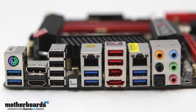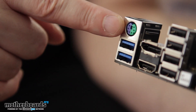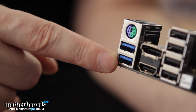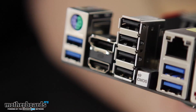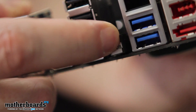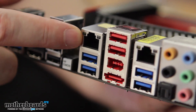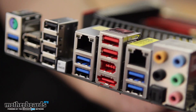Let's take a look at the I/O panel — I really like the design on this. Starting on the left-hand side we see a legacy PS/2 keyboard port, which is good for people who prefer those older devices. Below that are the first USB 3.0 ports. To the right we have DisplayPort and HDMI, then four USB 2.0 connections, and the clear CMOS button. One thing to note is this board features dual LAN, or shotgun technology, which means you can use both LAN ports at the same time for increased speed, sending and receiving simultaneously.